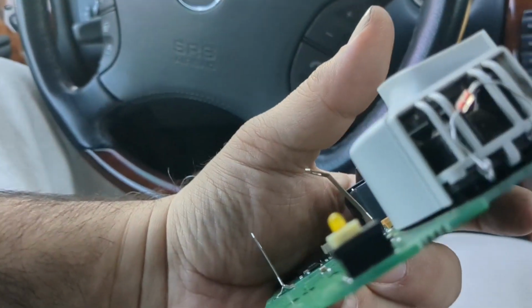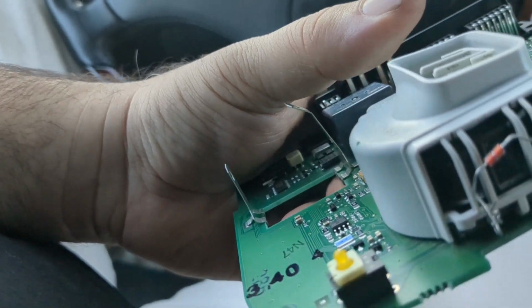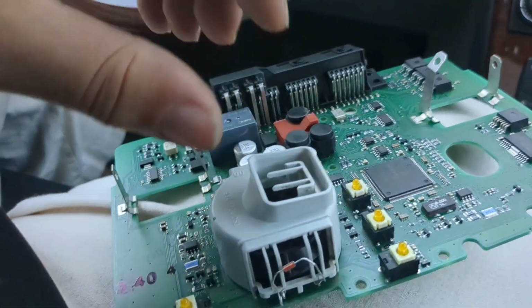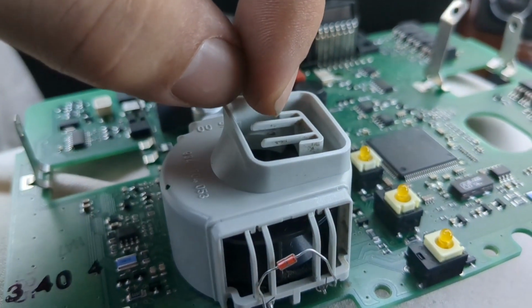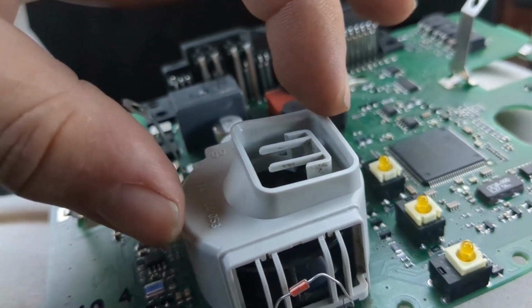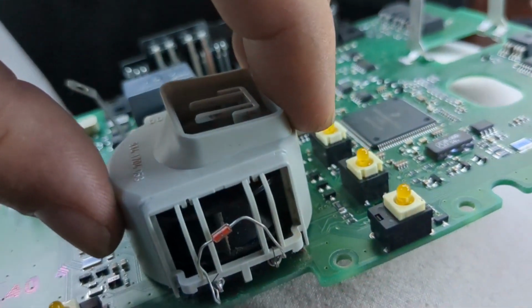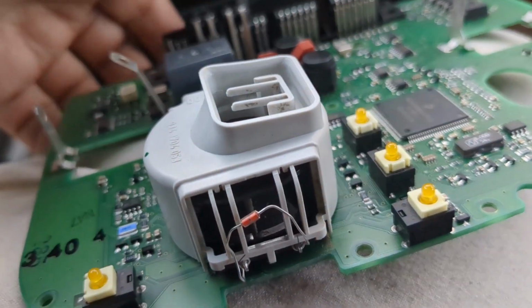You can plug this thing in before closing up everything and test it by turning on the car and looking at that NR1 value in the heating and air conditioning console. You should immediately see a real number there.